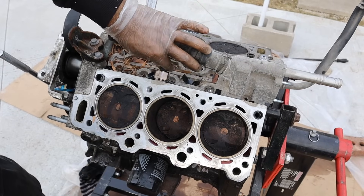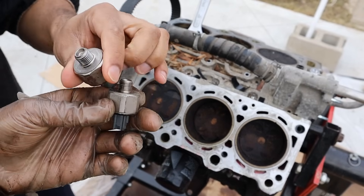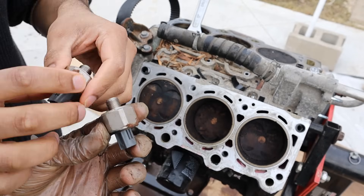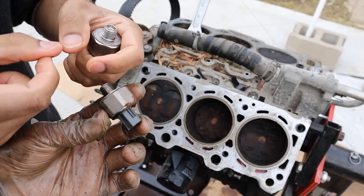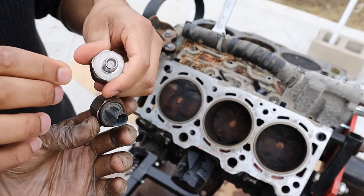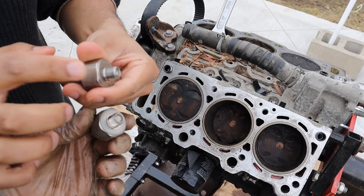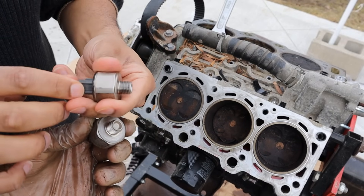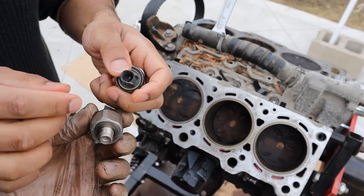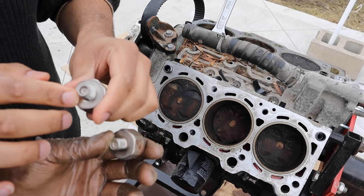Knocking the knock sensor loose and unbolting it. My electrical engineer brother explains how this works: it's a piezoelectric transducer with two signals — input and ground. The inside is essentially a very thin piece of metal that the ECU biases with about one volt; it vibrates at the tune of the engine, filtered to a specific frequency. If your engine is knocking, this transducer is tuned to that specific knock frequency. That signal in that frequency range gets amplified back to the ECU, which then uses a DC blocking cap filter circuit to determine the amplitude — essentially the amount of knocking.